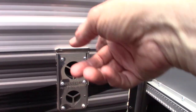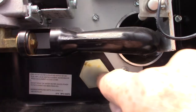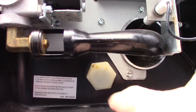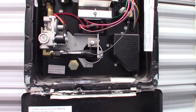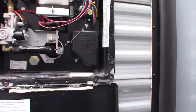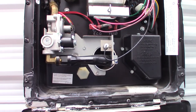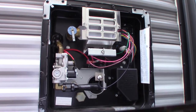Down here is a vent for your propane furnace. This is the water heater — it works on both gas and electric; the switches to operate it are inside the trailer. This drain right here takes a one-inch-and-a-sixteenth six-point socket with an extension and ratchet — that's where you drain the tank. If you're camping in spring and you fill the tank, after de-winterizing, drain the water so it doesn't get stagnant. Always fill the water heater tank before turning it on so you don't burn out the heating element.